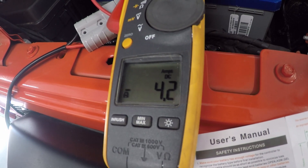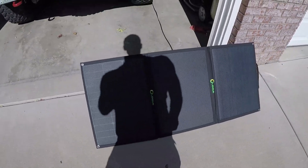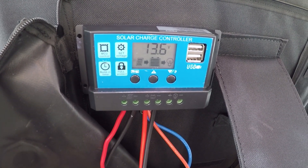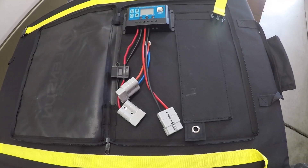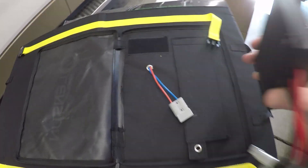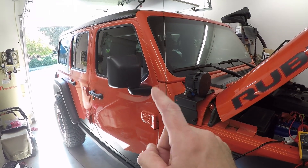We're still dumping about 4.2 amps into the battery. Let's wander over to the solar panel. Each panel comes with this velcro leg that you just swing out and sit on the ground, and it holds the panel up for you. With it pointed basically properly at the sun, it shows current going from the solar panel into the battery. The solar charge controller is literally velcroed right to the back of the panel — it's all inclusive, you don't have to have this permanently mounted on your vehicle.